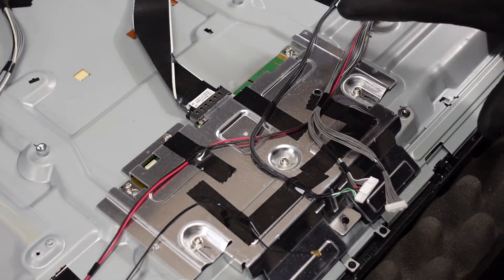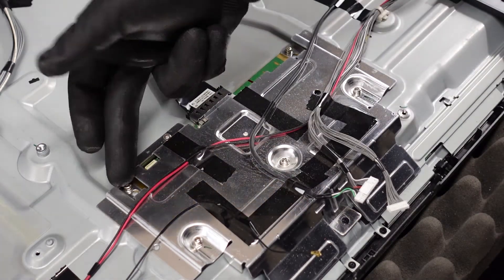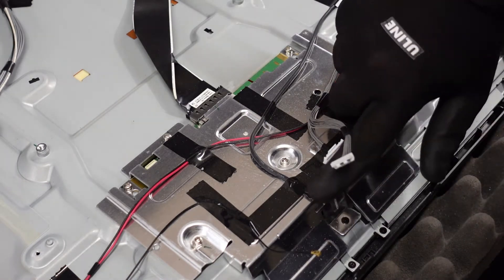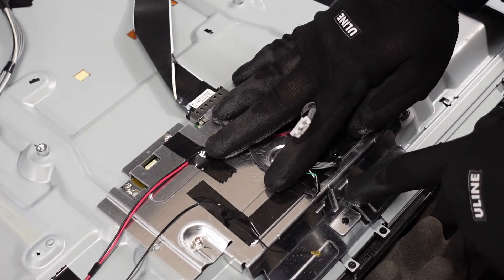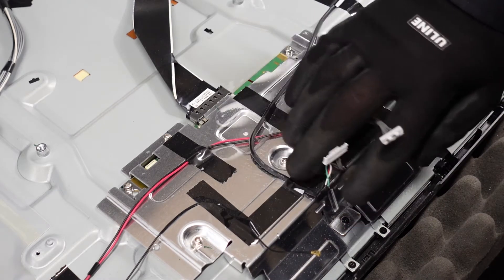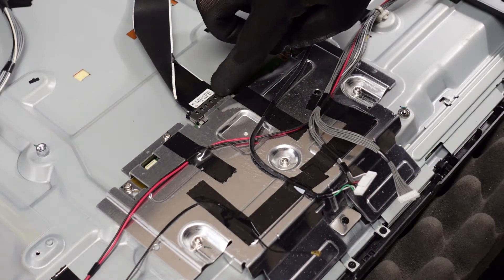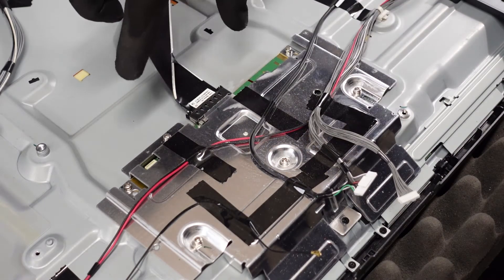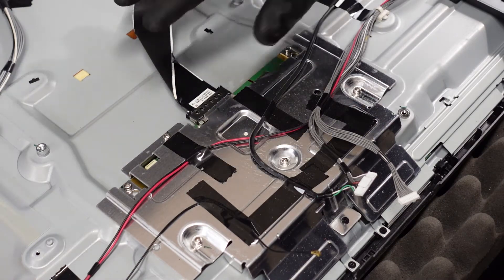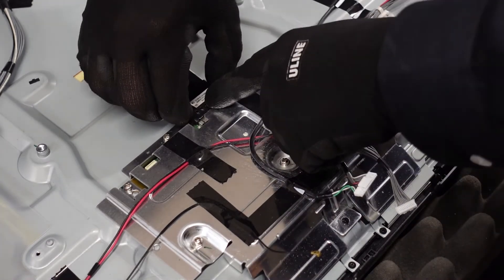Taking a look at this, we'll notice six screws that we can use our drill on. There is one more small screw down here at the bottom — we'll want to use a number one Phillips head screwdriver for that. For what we're going to do right now, let's disconnect this LVDS cable to get it out of the way. We're just going to pinch it on the sides and pull it out. These can kind of give you some grief if they've never been handled before, but just don't fret, just keep working with it.